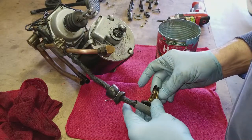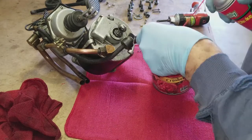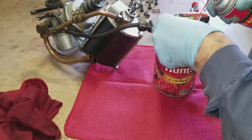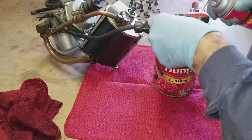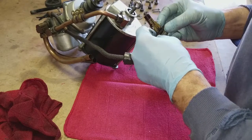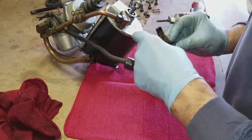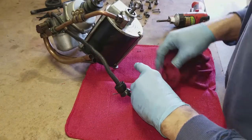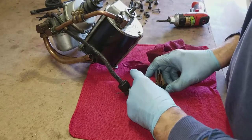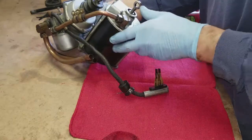Finally, having looked at it pretty heavily, I'm going to clean this off. I'm using a little carburetor choke cleaner and spraying it off heavily into an old tomato can so I don't get it on the electric hand's paint, but I get the stuff cleaned out real well. I'm going to wipe off some more of the residue. I've already noticed the gaskets here aren't good - they're going to have to be replaced later on.